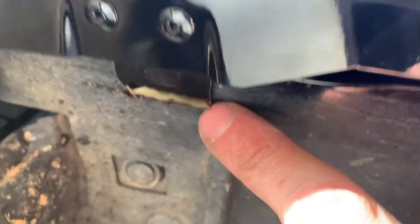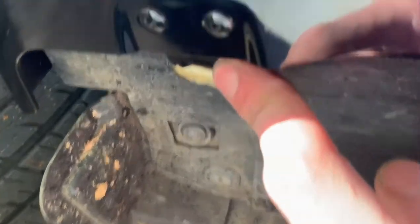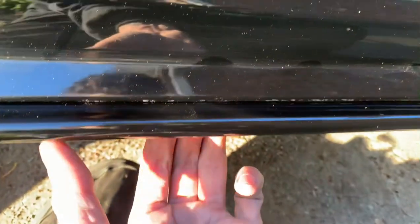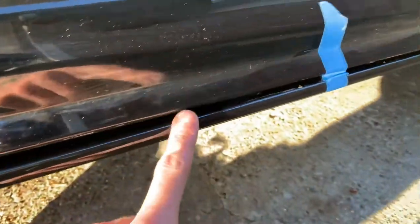Underneath here I have a screw — this is the first one. This bracket comes with tape on it, and they tape this off and rivet it. Unless it has holes underneath this tape, once I peel it off I'll be able to put one there. The others you're just screwing directly into the plastic down here. There's a body line you can see — you don't want it way under there because it'll taper in. As I work along I'll pull the tape out as I put the screw in, just to make sure everything is flush and sitting where I want it the whole way down.